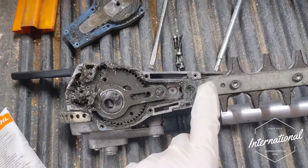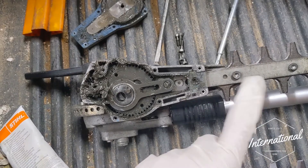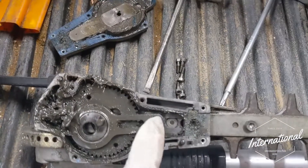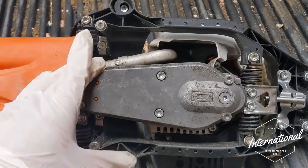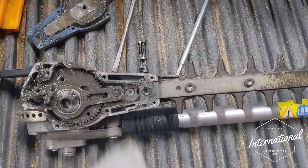Once you've got to this point, there's always one nut that holds the blade unit in, and all you need to do is undo that. There are two types of blades that Stihl do on the end. As you can see, this one just has a pin that sticks out a little bit and slots into this hole, and that's what moves one blade with one static. But some actually have a loop attached to them — on this bigger model and like the HS45, they have a loop that goes onto the cog, but these don't; these just go straight on here.